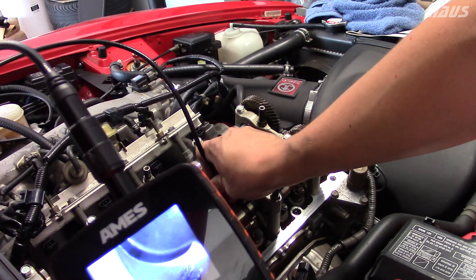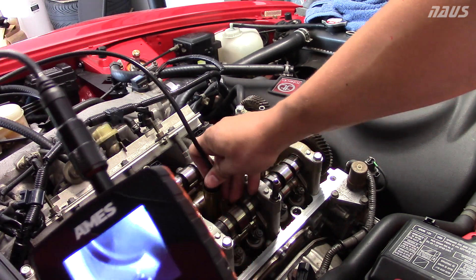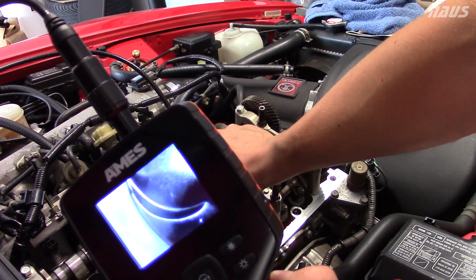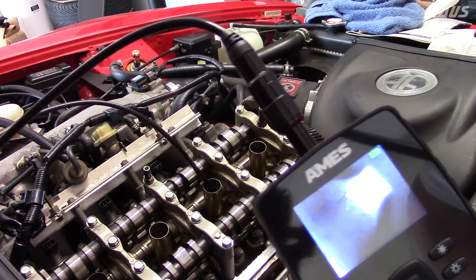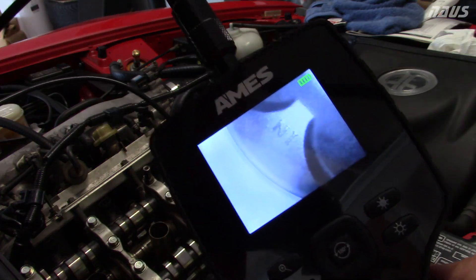There's no marks on those two. I'll go around and spin this whole device around - the cable is pretty stiff so I have a slight bend into it. To look at the side of the piston, not directly on top - you can kind of see the others by rotating it. I'm not going to show every single one, just looking for any signs of a mark from the valve.